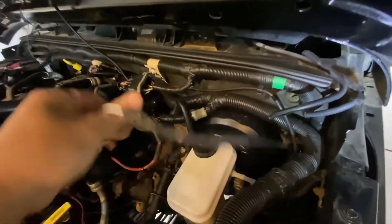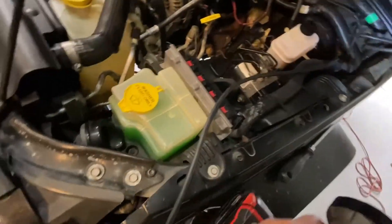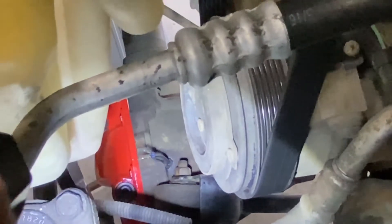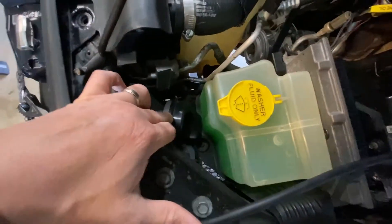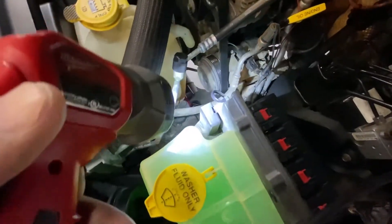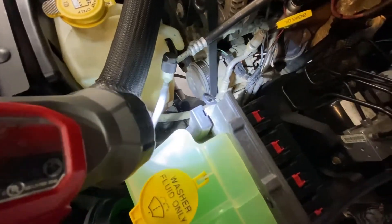Okay, so there's the female side of this wire harness. Now I need to figure out the best way to route this down into my differential. I found the best place — those two black cables sticking out of my differential, which come right above the belt or the coolant reservoir. What makes the most sense is to bring this harness behind the windshield fluid reservoir, next to my horn, then straight down away from all the engine heat, and sneak it down next to the cooling bottle. Make sure to leave enough slack down there — you don't want it tight, so as your axle is flexing you're not yanking on that cable.